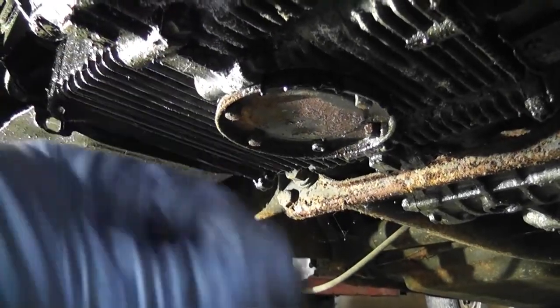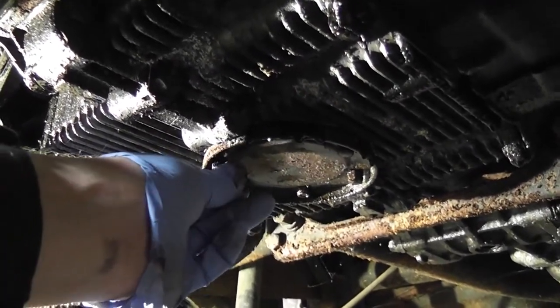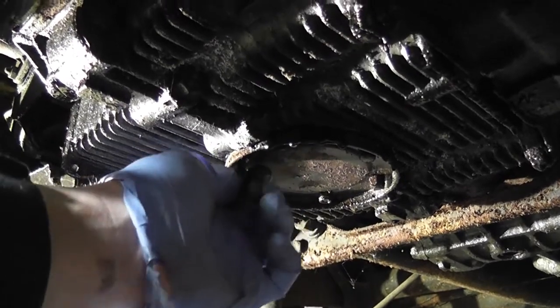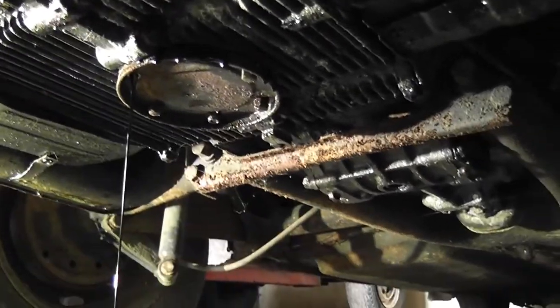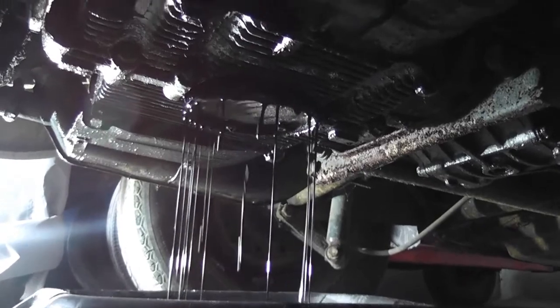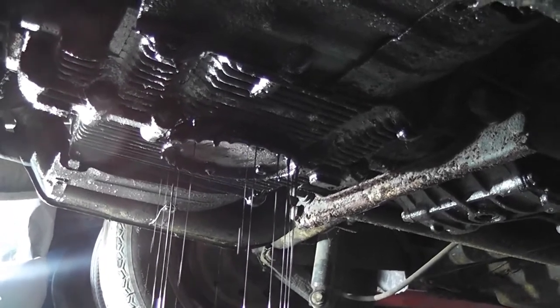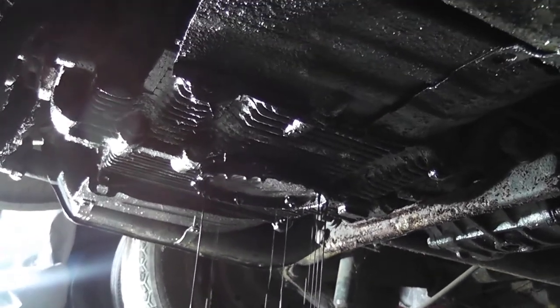You'll see why I'm wearing gloves — this is a nasty old job on a Beetle. In their infinite wisdom, they didn't put a drain plug on the bottom. Some Beetles do actually have a little drain plug on the sump plate which makes it a lot easier. Now you can see a stud has come out with this nut, so the oil is going to start pouring out. We'll leave that draining for a while and get as much out as we can before we take that plate off, because taking it off now would make a horrendous mess.